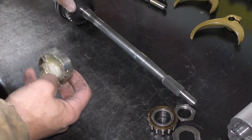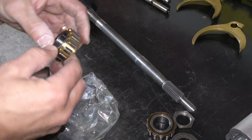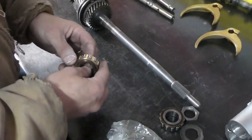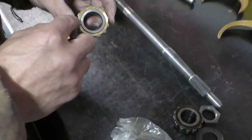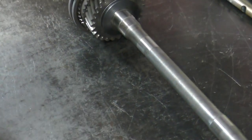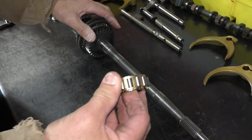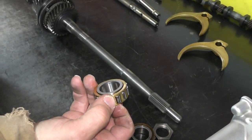We're going to be installing a new front bearing here. When we unwrap it we can see it comes with a brass cage and an outer ring that goes in the front of the transmission case. Looking at the bearing cage, there are two sides: one side has the little peened-over pieces that hold the cage together, and the other side is clean. On these you have to install them with the peened side facing towards the clutch disc, so when I put it on the input shaft the solid part of the cage goes up against our beveled washer. This is going to be an interference fit, so I'm going to heat this bearing to make it easier to install. You can also use a press.